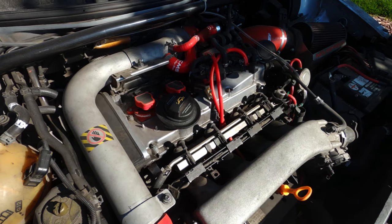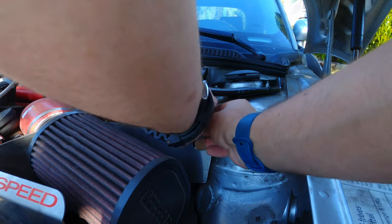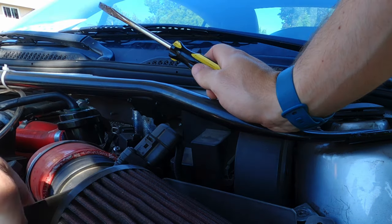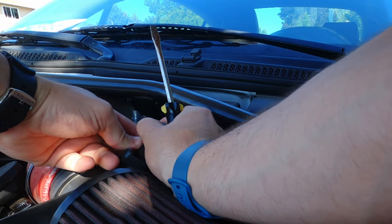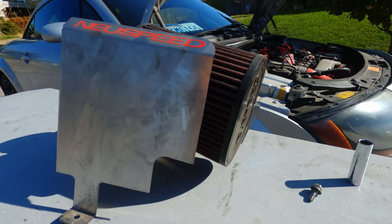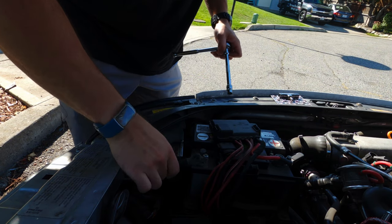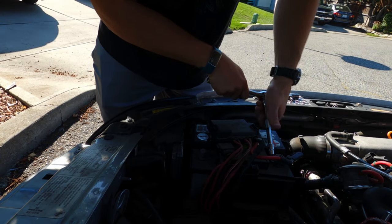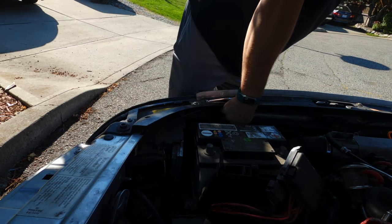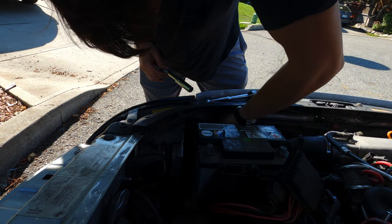The other reason we want to replace it is performance related. This acts as a direct bridge between the force you apply with your foot on the clutch and the actual action that the clutch does. The fluid channel in the stock bleeder valve is actually narrower than the hoses leading in and out of it. This restriction makes it harder for fluid to go through, and by design this makes your clutch feel a little bit more numb. The narrower section acts as a sort of harmonic filter on a lot of the vibrations and feel you'd get from the clutch itself. That's great for a daily driver, but for performance, clutch feel is really important. That's exactly why the bleeder block we're installing today removes that restriction — improving performance and reliability, which is a double win.